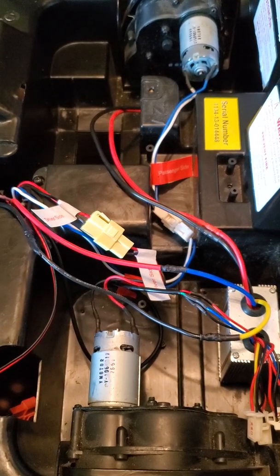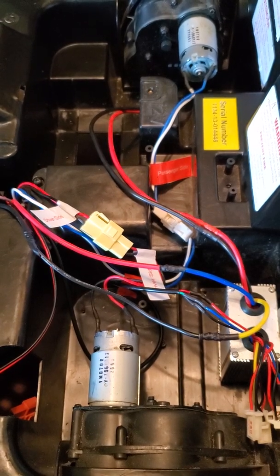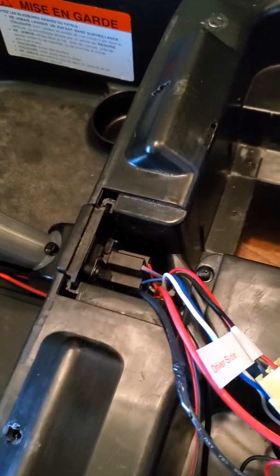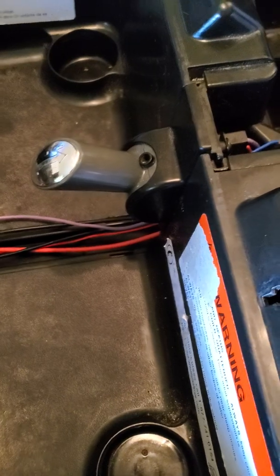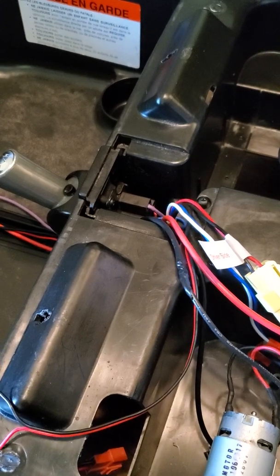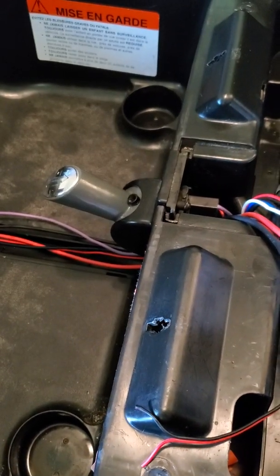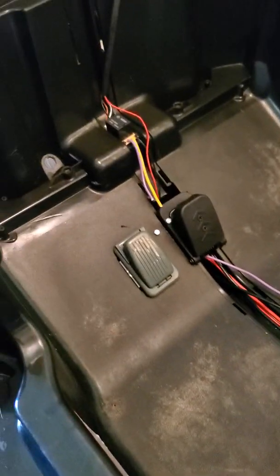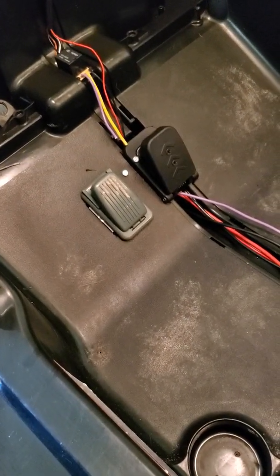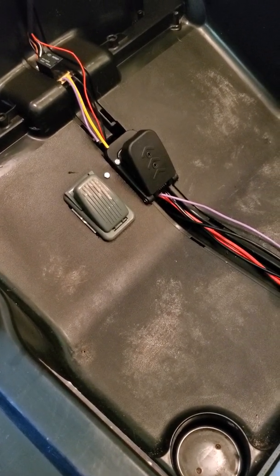They tend to use a lot of different colors that aren't easily identifiable as positive and negative. I really didn't have to play with anything on the back of the shifter — I only lifted it out a couple of times just to route the wires underneath it. I know that's probably the most intimidating part with all the wires running to the back, but I didn't have to do any modifications to the shifter. I still have high, low, and reverse, the ability to use all the accessories up front, variable pedal, and soft brake. Thanks for watching — if you have any questions, just send me a private message.